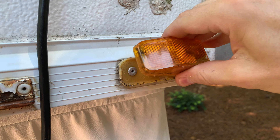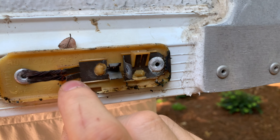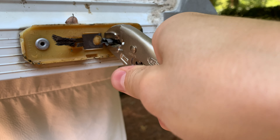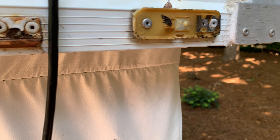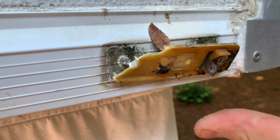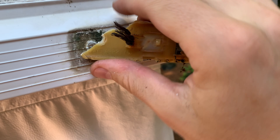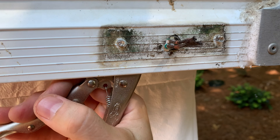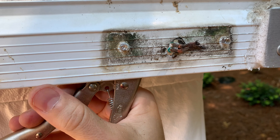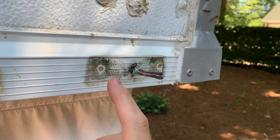First, take off your light cover, remove your old bulb, pull up the old wires which are just held in by these little crimpy things, and pull that off. Drill out the rivets here carefully so we don't punch through to the canvas. You can see that plastic is a little delicate. Now these wires will just pull right through the plastic. Peel off some of the caulking on the wire, use some vice grips to get out the back of the rivets. There we go — this is now ready for the new LED light after we brush it off a little bit.